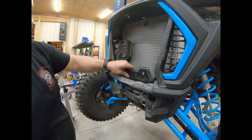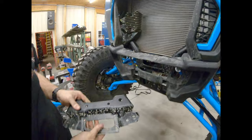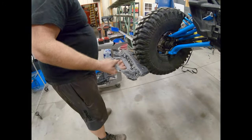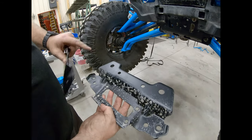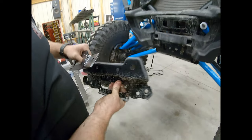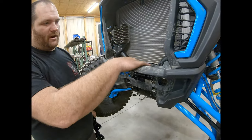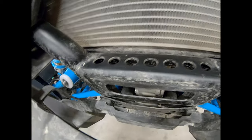Set the grill to the side and pull this plate out from the top. That's the factory plate, and this is the adapter plate. The main difference is this whole top section — the reason we don't mount the bumper to this is because it just has no strength; there's no box gusset to anything. Our bumper is going to mount off the frame right here.